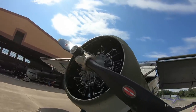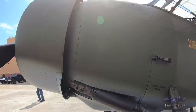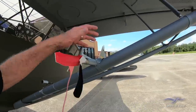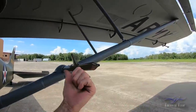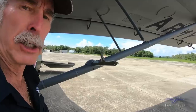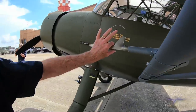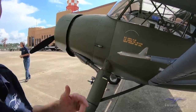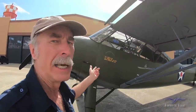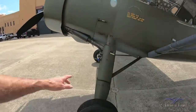We're just looking for oil leaks, different things, fairings, cracks in the exhaust stacks, making sure all the cowlings are buttoned down — 'removed before flight' is always a good thing. That's the pitot tube — this is going to give us ram air pressure for our airspeed indicator. These little holes on top are actually a static source; the wind's going parallel, perpendicular to the holes, so it determines the ambient pressure. When I get in the airplane and look at the manifold pressure gauge, it'll tell me basically what it is — probably about 29½ inches of mercury today.